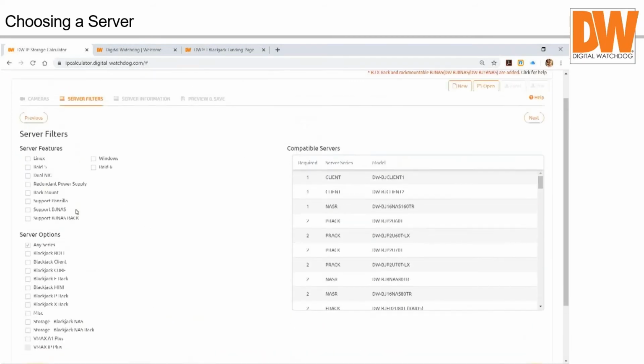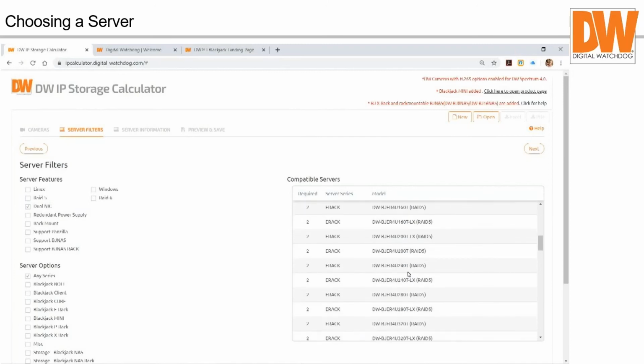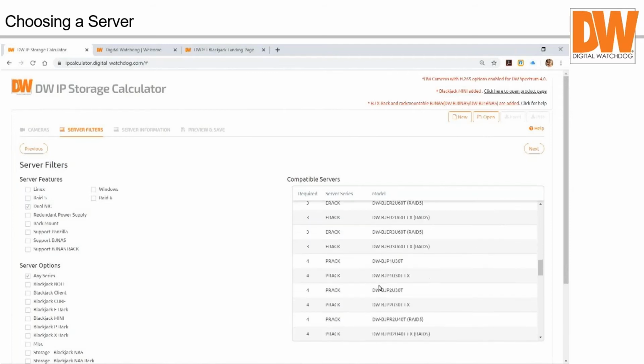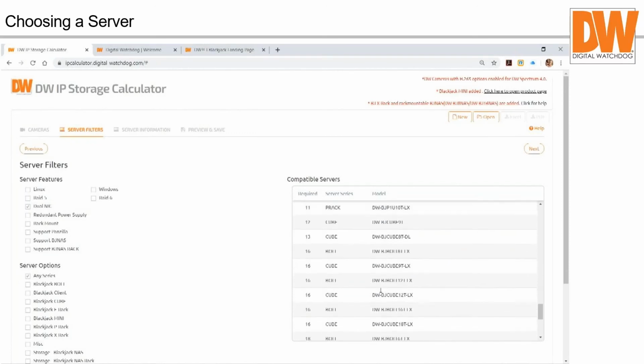And we can choose the servers we want to try. The customer says we need, or I'm sure they need, redundant power supplies and dual NIC, and we can just look down the list here and decide, oh, I need 2 P racks, 2 E racks, 2 X racks because of the storage. And then it gets down to 3 because they have less storage in them, but you may want to account for failover. So you may want a 3rd one because the customer wants recording redundancy as well as data redundancy.